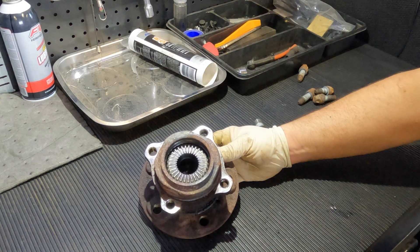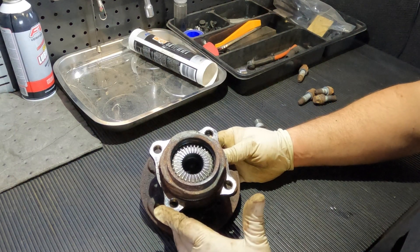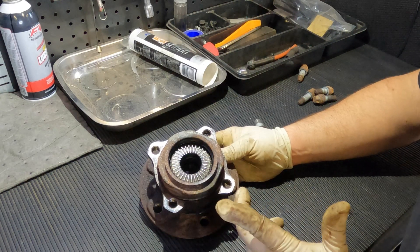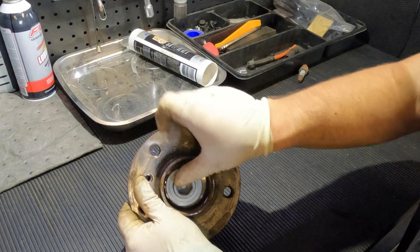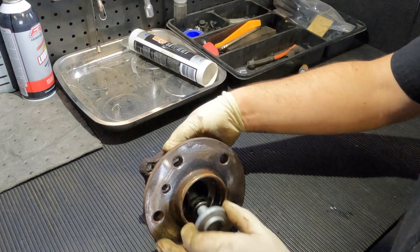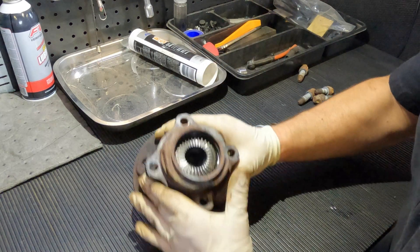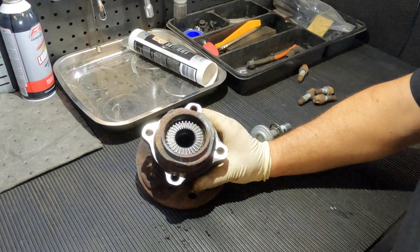The way it works is kind of unique and very interesting, but it's also very weird if you're used to the traditional stub shaft with spline style wheel bearing, which I'm more accustomed to. This design has a couple of advantages — and they're not really advantages for you the consumer, more very nice for me the mechanic. The biggest thing I like is you don't have to remove the wheel bearing to get the axle out. You just unbolt the axle bolt and you can remove your axle without having to remove your wheel bearing or knuckle assembly.